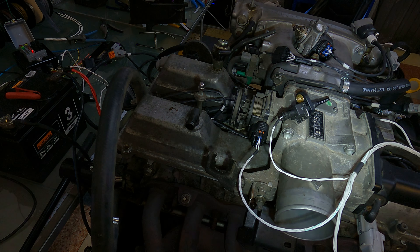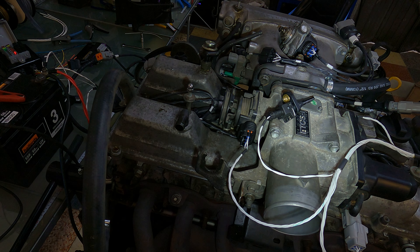That's what I was saying in the other videos about the modular harness — you can chop and change as you like. So effectively, this customer's got this setup with idle control valve, TPS, and IAT. But if the customer wanted to change over to an actual drive-by-wire throttle, so he could take advantage of things like cruise control, anti-lag, all of that type of stuff that comes with the benefits of drive-by-wire, he would just have to phone us up and we'd make him a separate harness, and then obviously that's fully functioning drive-by-wire.